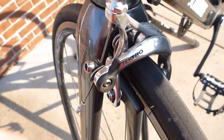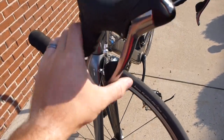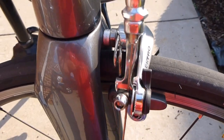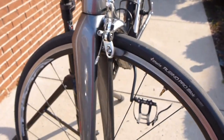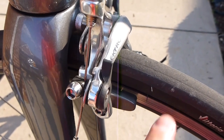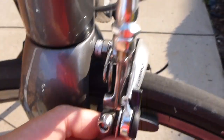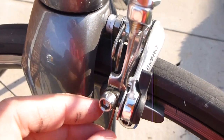That's important because when you're tightening your brakes you want to not only brake more firmly when you pull the brake lever, but it'll help you stop a lot faster. If it gets too loose you can coast a little bit, and if you're having to stop quickly it could really pose a problem. So have the brake pad in the most outward position, loosen with a hex key, then pull the wire down and get it as tight as you want.